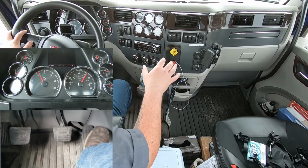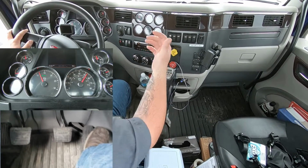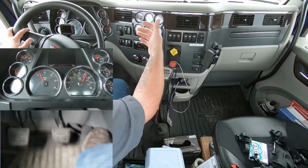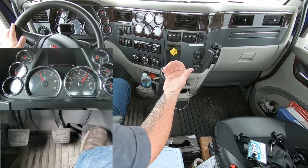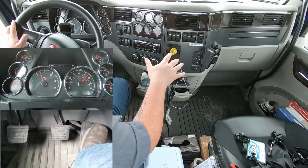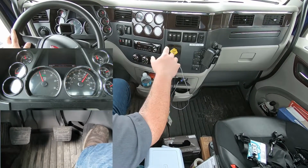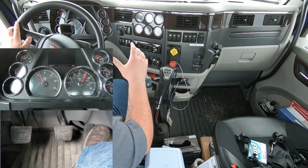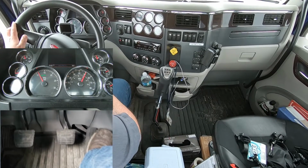That going from 9 to 10. Go too fast, you'll grind up against the gear. So it's more pull it out of gear and just take your time going into 10th gear, because going from 9th to 10th on a 10 speed like this, the RPMs are going to drop a lot. I wouldn't say really slower. You just don't have to move it as fast as you do on the lower gears.